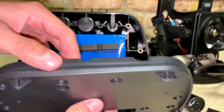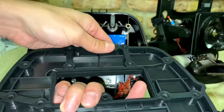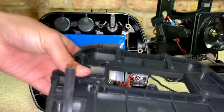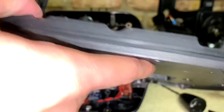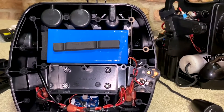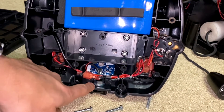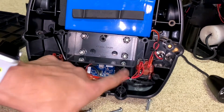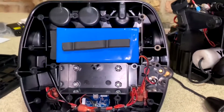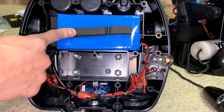This is what I wanted to see — it has an O-ring around the bottom base. I still probably wouldn't trust leaving this in standing water because look at that: all the components are right at the bottom. Not much room from the bottom of the base to all the wiring — you'd fry a lot of stuff if you're not careful.